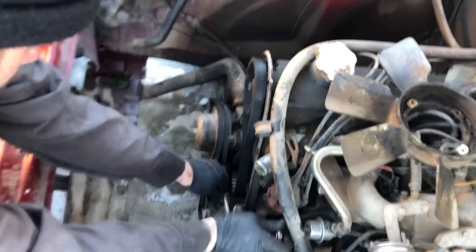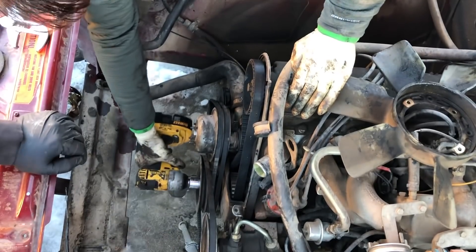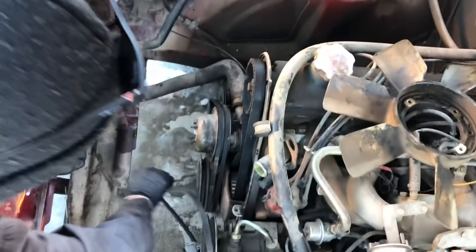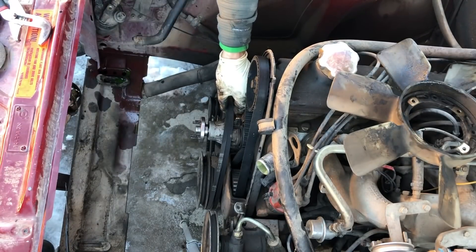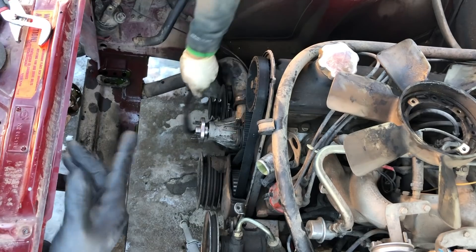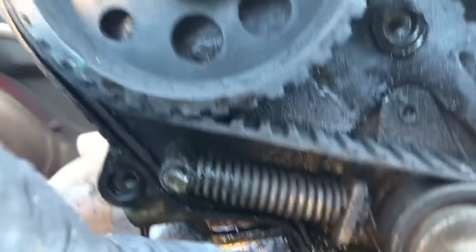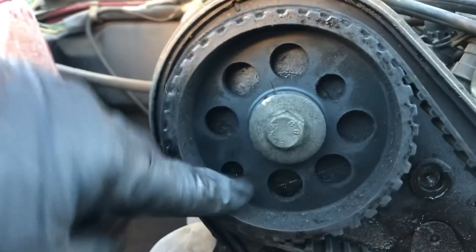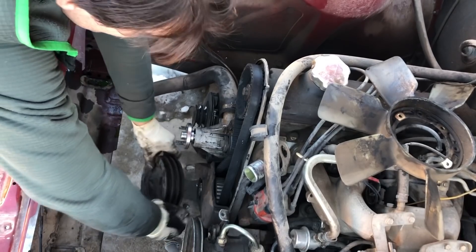This water pump ain't too old — only since 180,000 miles. I have to show this: all of this oil is a good sign that your cam shaft seal is leaking. Thankfully you don't need a puller for these kinds of crank pulleys. I'm gonna roll it forward. Oh, we never disconnected the battery — I'll disconnect that battery cable now, negative. One of my fears, like in Breaking Bad when he shorts out the BMW at the gas station — I'm Walter Whiteface.